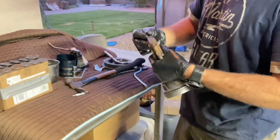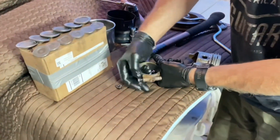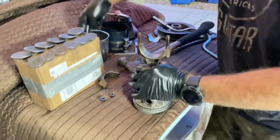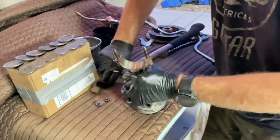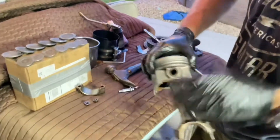Here's our last piston. There are no connecting rod bearings in right now, so we're going to take the cap off. I always put a little bit of oil where the bearings go — just the thinnest layer — and that one's going to sit there for a while.